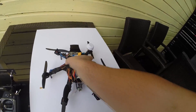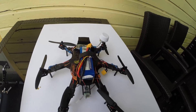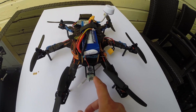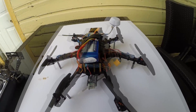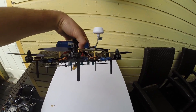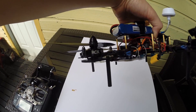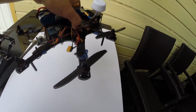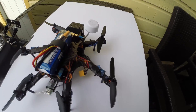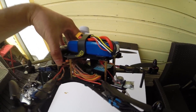The only thing I did was clean up the wiring and move the battery back, so now when you give it full throttle it goes straight up. There's a battery voltage low voltage alarm. It's still using the ZMR 1804 2400kV motors, also known as the RCX motors, with 5x3 props, Emax 12 amp pre-flash SimonK ESCs, running a KK2 with 1.6 firmware.